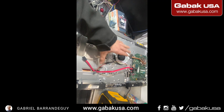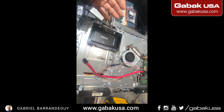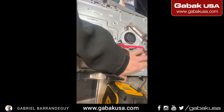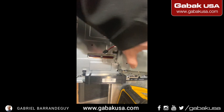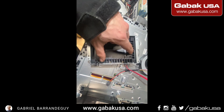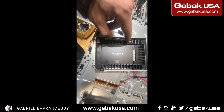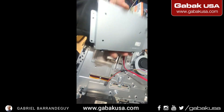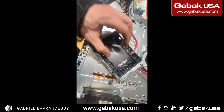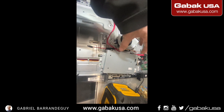The cover is off — I explained in another video how to remove it, so go to my channel or ask me for the link. Now, the old hard drive is in this position — remove the screws and take it out. You need to buy a 3.5-to-2.5-inch adapter, which you can find on Amazon — I'll leave the link in the description. Put any SSD in the adapter, put it back, add the screws, plug it in, and that's it.